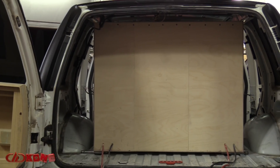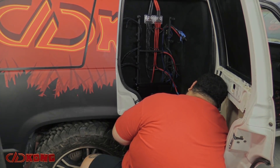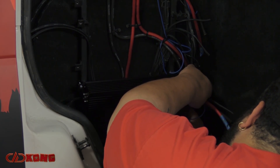By the time we got the enclosure inside the vehicle, we only ended up with about 15 inches of depth. The space in the back was super premium — we didn't have a whole lot of room for extras. Rather than running several dozen individual power wires for all of the mid and high amplifiers, we just ran a pair of positives and grounds directly from the battery bank up to the four channels.